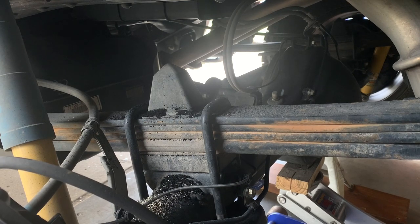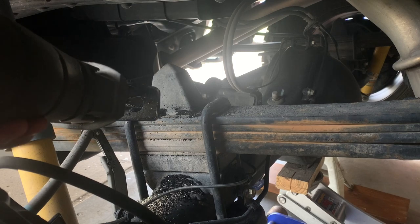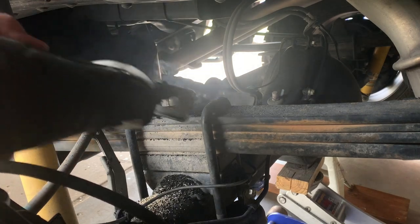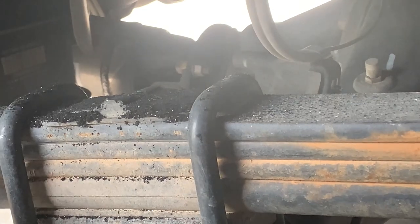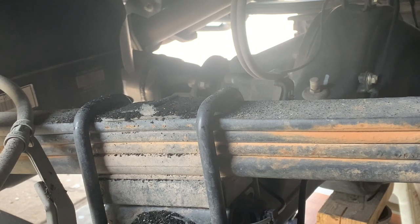That smells something awful! There might be an alignment pin under there because it feels hard once I get to the middle. Alright, so there was an alignment pin — an alignment bump. I thought you could just take it off, but you can't, because you need these lips of the bump stop to hold your leaf pack together. I'm going to blow this off with some air so we can continue.